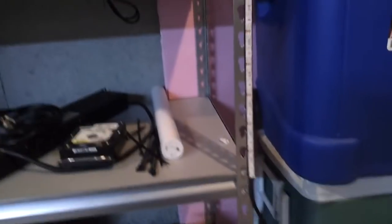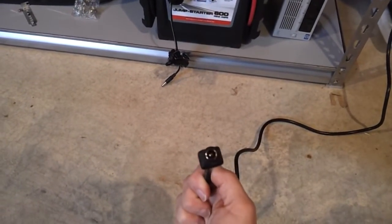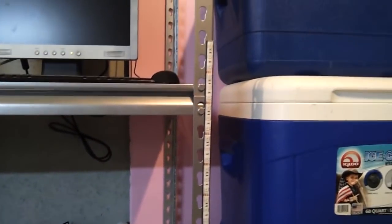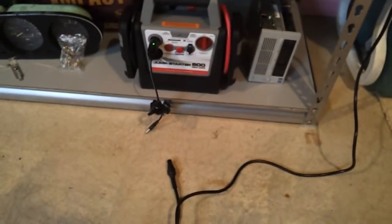This is just a little cheap jumper battery you'd buy at the auto parts store. What I actually had in mind was running this into your car's cigarette lighter plug — you're working on a car, why not use the car's battery to power it. Obviously a 12-volt power pack that can supply 5 amps or however many are required by all your LEDs is ideal also. When you're working on cars, a lot of times you're not too concerned about how much power you're pulling because you're not running it the whole time — just while you're working for a couple hours or whatever.